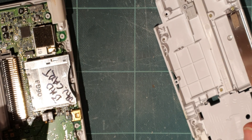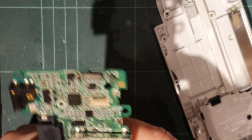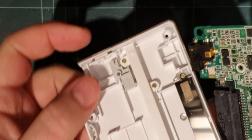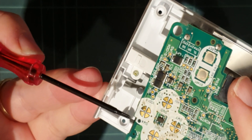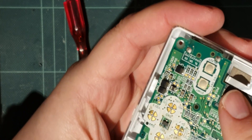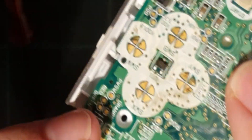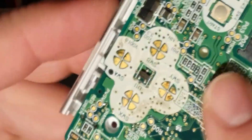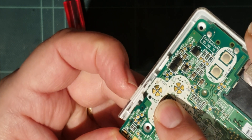Let me get a board with a working switch on. I can see on this board the switch is there and the little black bit is on there. So when you're putting this together again, what you've got to keep working is that little black peg — the bit of plastic that switches the switch — it has to go exactly in between the slidey bit. I'm just showing you this because it's the best way I can get to this bit so you can see. When you've got it all aligned perfectly, the plastic on the outside is moving that switch on the inside.